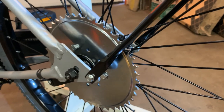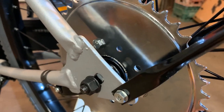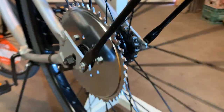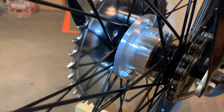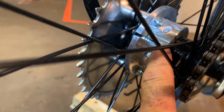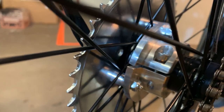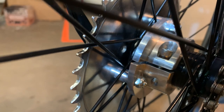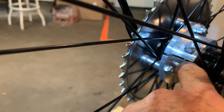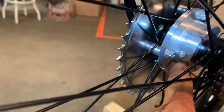The end result should look something like this - machined in the center, rear bearing cap still on, dust cover on, bike sprocket firmly tightened. Hub mount is on and installed correctly. As I said before, if you do not have a gap on one or both sides - I prefer both, that way I know it's tightened evenly - then your aluminum sprocket mount is not gripping your wheel sufficiently. So if you don't have it like that, you can take some material off the top side and the bottom side of both sides to cure your problem.